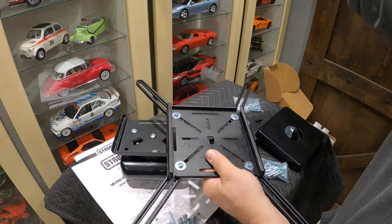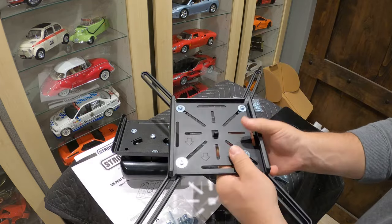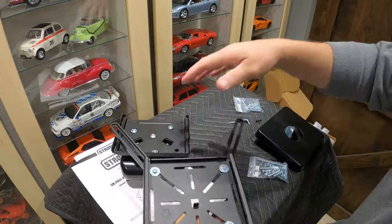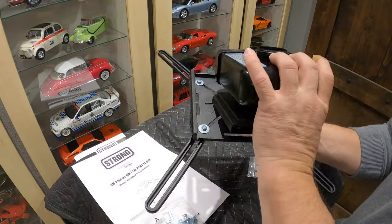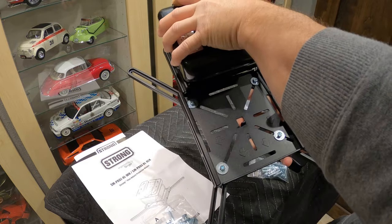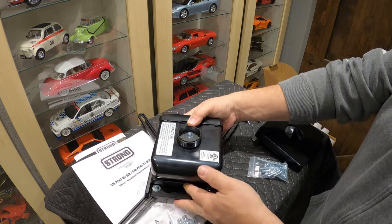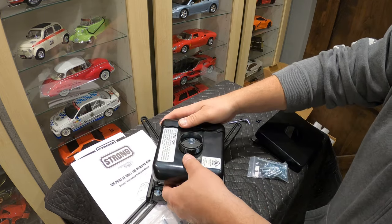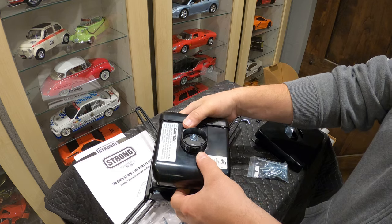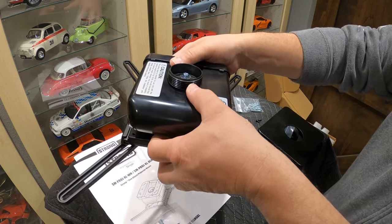Here you can see it's got four Phillips head bolts that let you adjust it onto your unit. You're going to use your metric hardware into your JVC or Sony — JVC and Sony are all four mounting points. I think Epson, Optoma, and a few of the others are three. Once you have this mounted to your projector, pull it up from the center and your projector should stay level. If it dips hard to the front or hard to the back, you need to reposition your mount — you should be able to lift it dead up from the center.